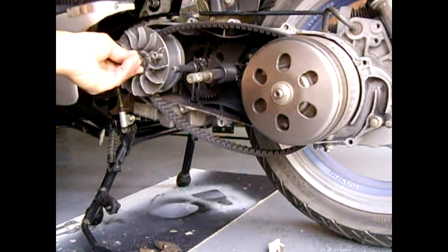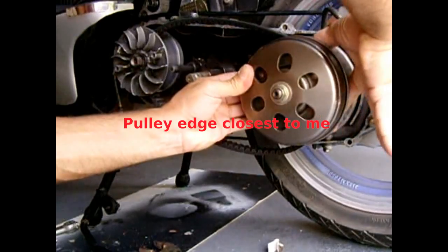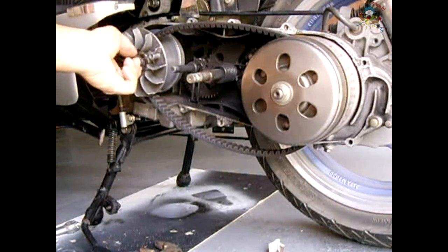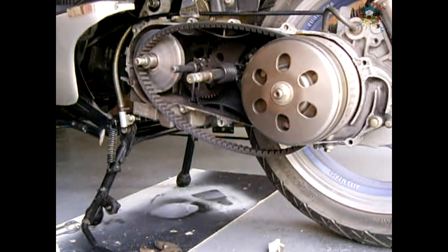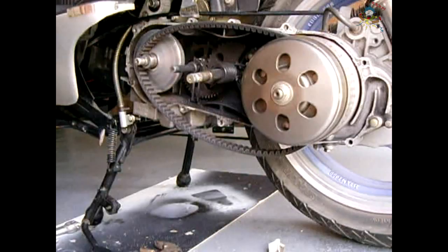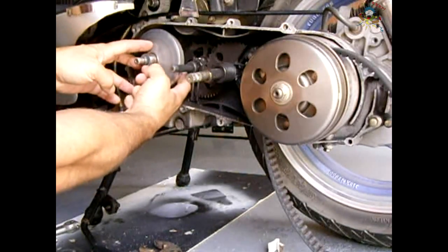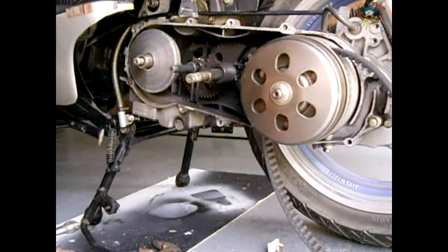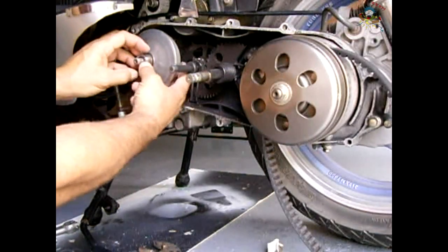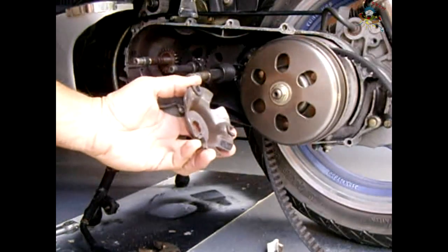As you can see, this has been loosened all the way. What I did is I grabbed the pulley, squeezed it hard towards me, and shoved the belt in deep to make it very loose. Then I loosened the nut and pulled the plate off — it's in pretty good shape considering it's original and has around 12,000 miles on it. Pull this out of the way, then reach behind with your finger, grab the back of the assembly, and remove the whole thing.